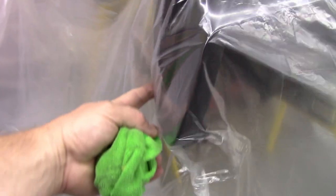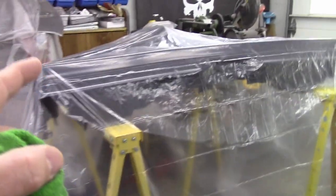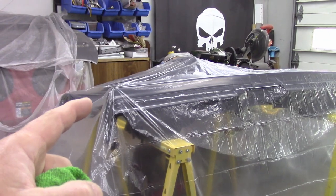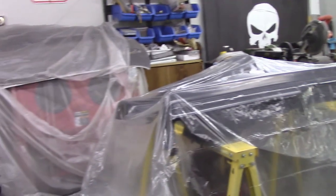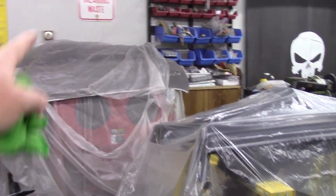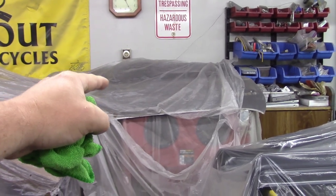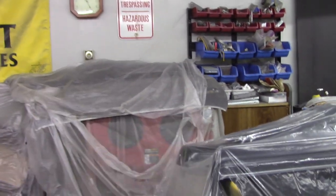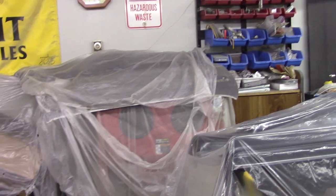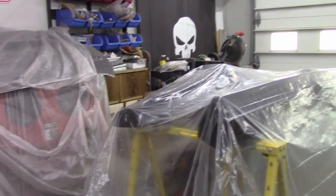Should I paint the jams of these bumpers, just the inside edges here, and put them back on the car, and then use the foam backmasking soft edge tape in the gaps when I paint the whole car, I would do the exterior surfaces. I've also got the lower valance that goes under the bumper, and then the trunk filler panel that goes over the torsion rods to do as well. So I could do those jams with the bumpers all in one session, reassemble them on the car, and then do that soft masking.